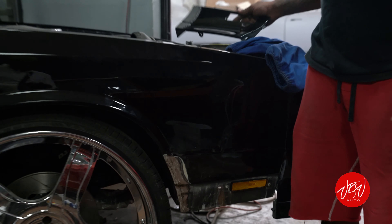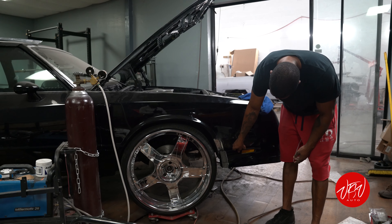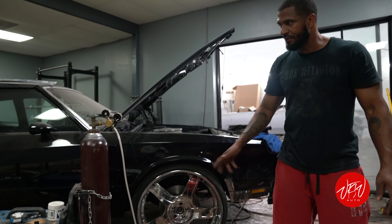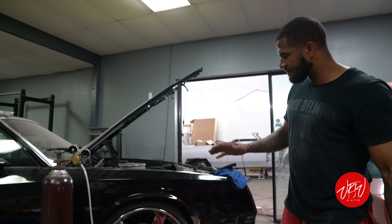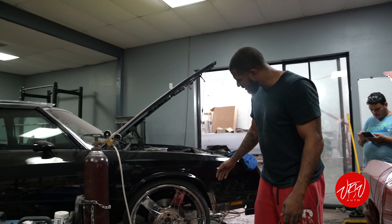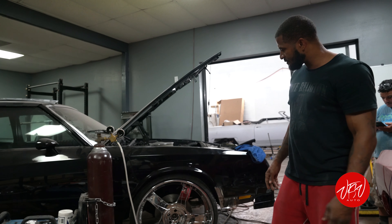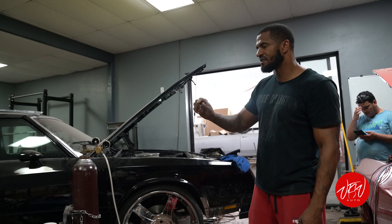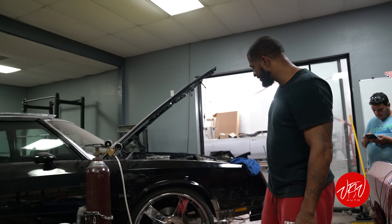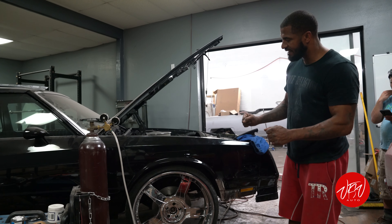The same goes for the groove line in the back. The marker light bezel has to be modified as well, but once we have body work and paint done, it'll look factory stock. We've got adjustable coilovers on the front — we do need to go up a little in the front to get some rubbing off the back tire. We just have to get that spanner wrench adjusted back up to get us to the ride height and stance we want. Now that this opens up, everything can fit smooth and you'll have the full turning radius.